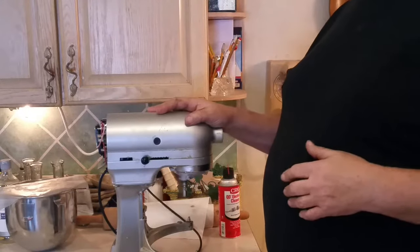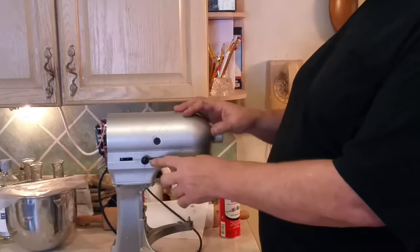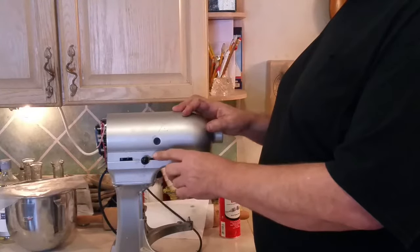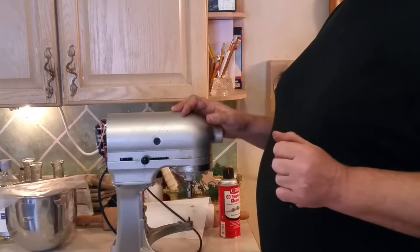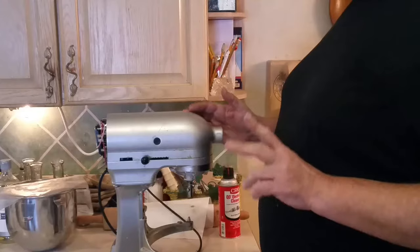It's not an electrical problem with the switch. There's actually no electronic controls, at least on these older commercial lift bowl models, behind this switch. The only thing behind this switch is a steel and plastic-coated rod that goes from here to the back corner of your speed control board to control your power for the motor. Some of the newer model ones do have that, but they're different — a little bit lighter-duty.